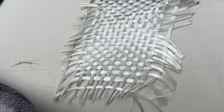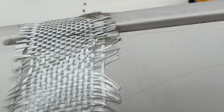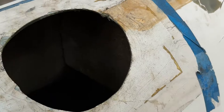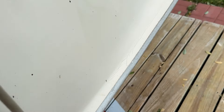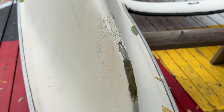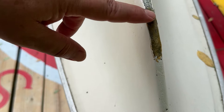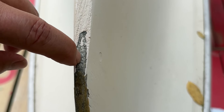I'm going to use epoxy resin and hardener, get it all buttered up and stick it inside there just like a little band-aid. We need to go through and look for all of these and get them patched up — these little gel coat pops. This happens because this boat is almost 60 years old, it's a 1965. See if you don't have a few gel coat dings and fiberglass issues when you're 65. This one here definitely needs more attention than what the previous owner gave it.